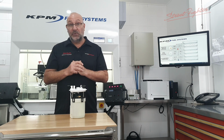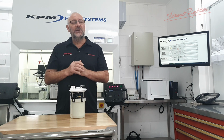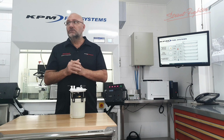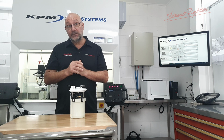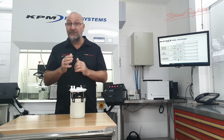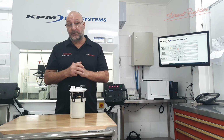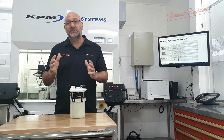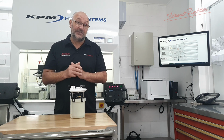It will support 700 horsepower at the engine. If we're talking kilowatts, that would equate to hopefully 450 rear wheel kilowatts on a WRX. It's about 520, 530 flywheel kilowatts. So quite impressive for a direct replacement system. Again, it eliminates all the need for surge tanks and any other items that we've been using up to now and in the past.